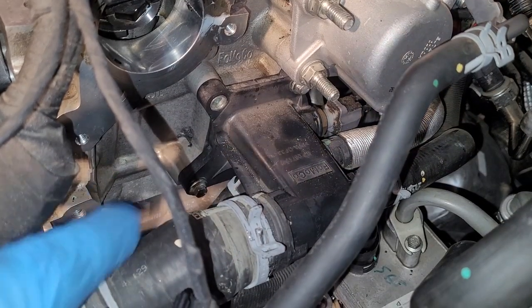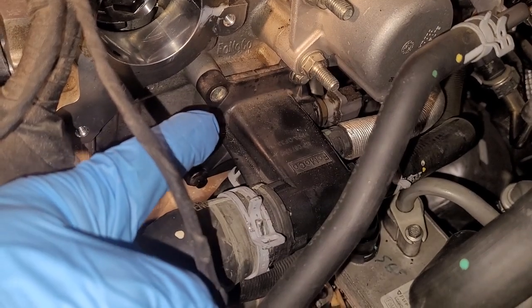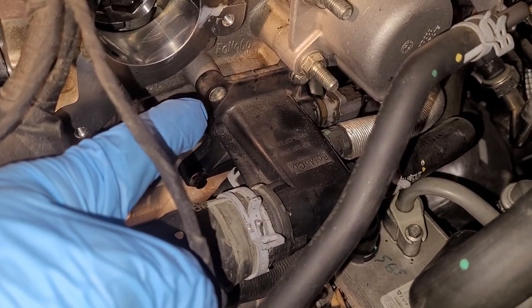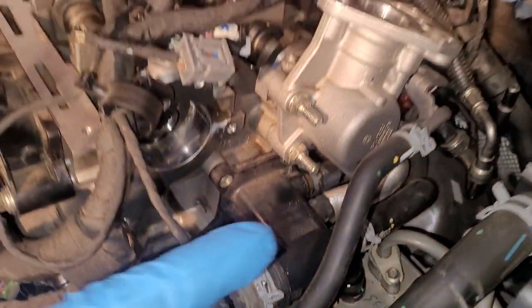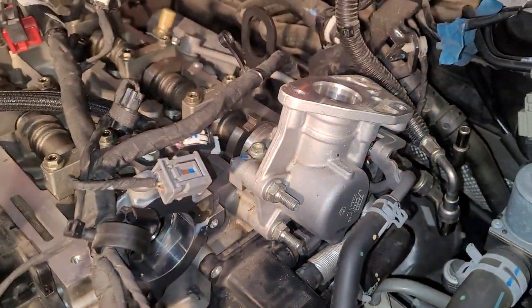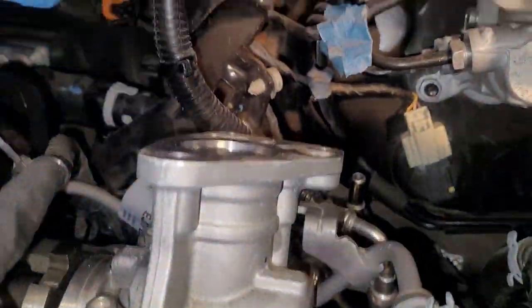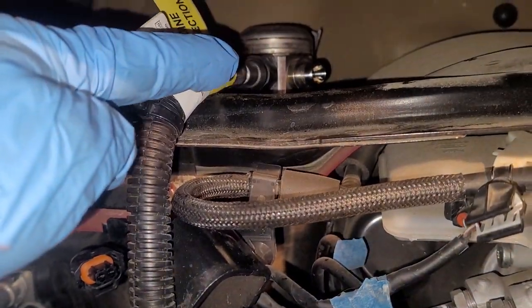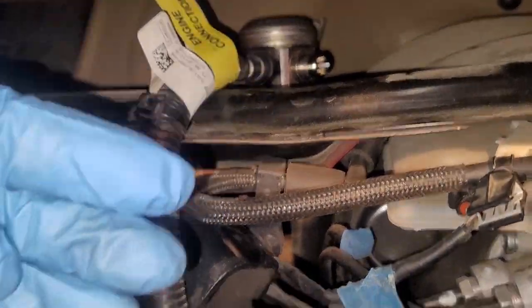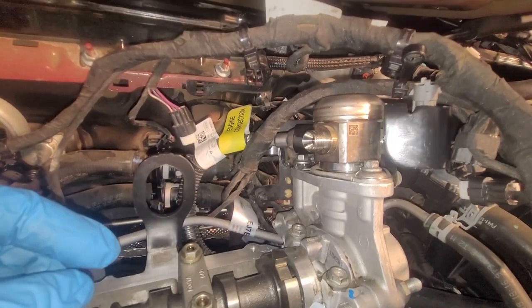This guy, let's put that back on. Water outlet pipe here, water outlet manifold is in. 3 of the 4 bolts are in. I'm leaving this one out and I'll show you why. It also holds the fuel pressure rail in on that one as well. So let's go ahead and put the fuel pump on the rest of the way here. The housing's on. I just leave the pump up here connected. I'm going to bring that down and put that on. 2 8mm bolts. Okay, the fuel pump is on.